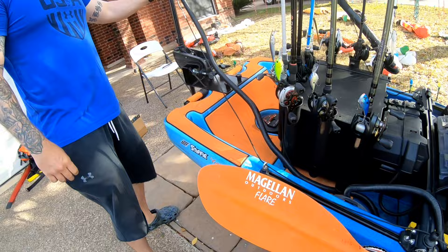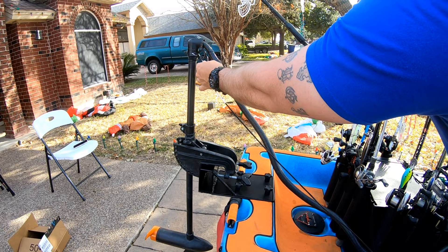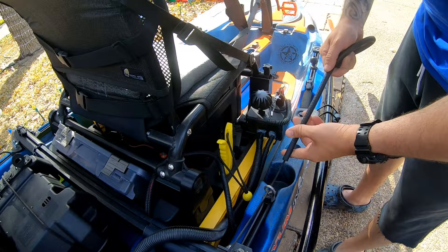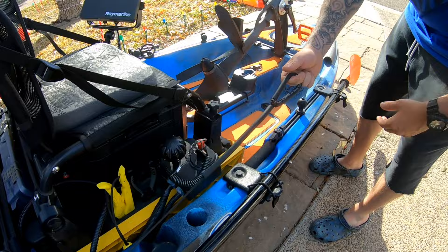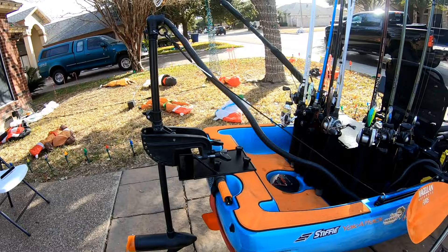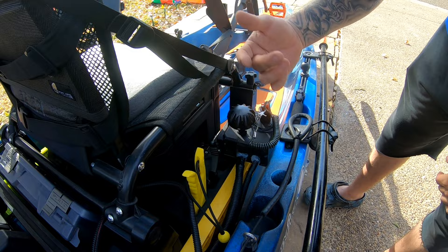Getting to the motor: I've got a Minn Kota, I believe 40-pound thrust. In the down position I've got 550 cord tied to a carabiner with an eye bolt — you can get all this at Home Depot or Lowe's. I've got the cord running through a Yak Attack eye bolt to keep it in line. I used some fuel injection hose I had extra of, cut it up with some shrink wrap, to make a little loop. When I pull the motor forward it goes up and rests on a one-inch ball while not in use. When ready, I pull it forward, drop the motor, and take off.